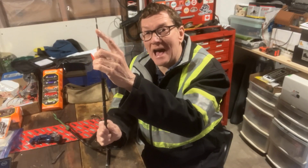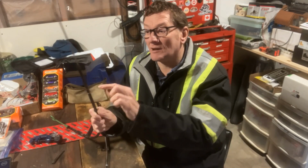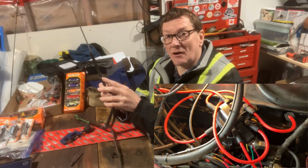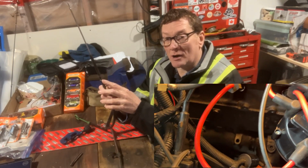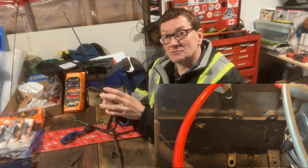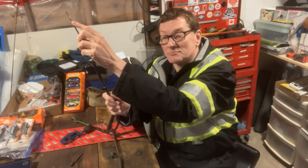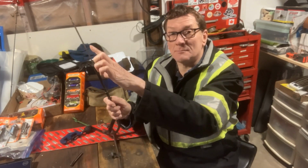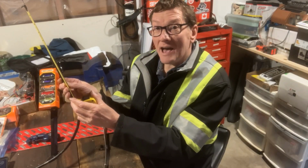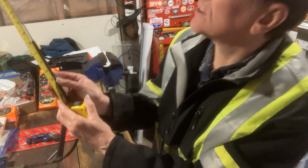and make a little bracket to hold it in place. So to find where the add and the full indicator should sit in the oil pan, I'm going to use this rib here that sits on the engine block boss as a reference point. So the measurement from here to the add will be the critical measurement. So we'll need to match that measurement to the new dipstick. So from the add to the rib, it's like 10 inches.